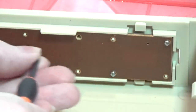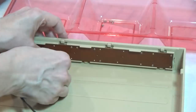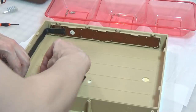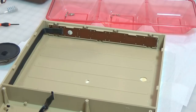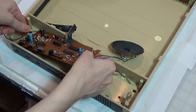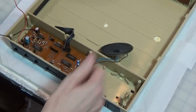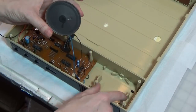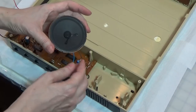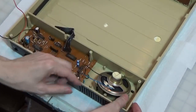Also handy to do that trick — back it up, wait for the little click, balls in, then screw it in. The circuit board was a little tricky to get out — I actually had to flex it a bit. It's got a couple of snap tabs on the left side and it has to slide under. Went in a lot easier than it came out. The speaker is interesting too — it's all molded in one piece, but these two little stands have flex and they've got little tabs that hold the speaker down. Originally I thought it was welded in place, but it's actually done with just a couple little spring tabs.